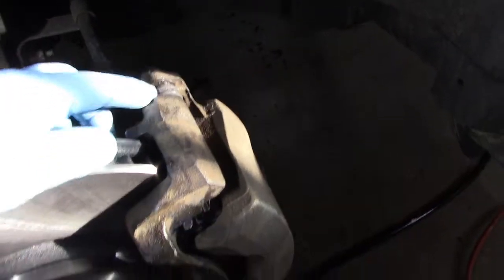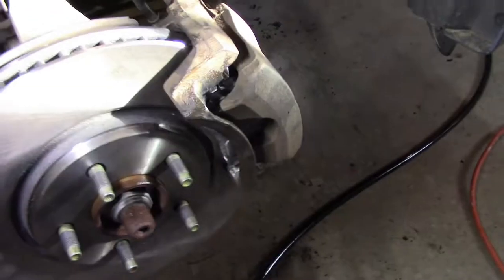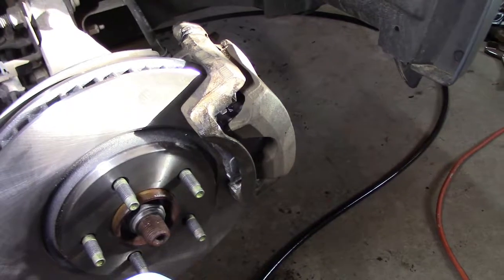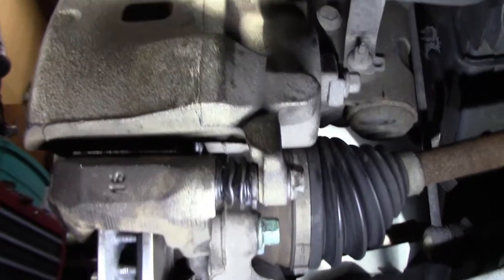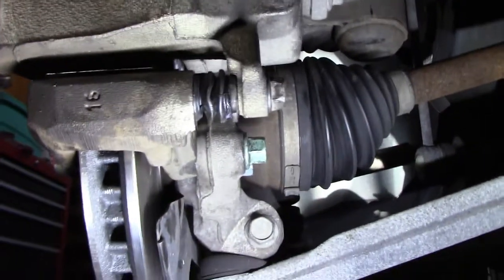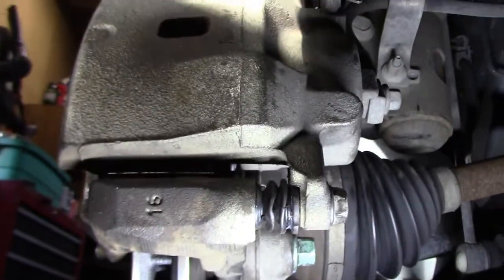Everything's looking pretty good so far. Boots look good. That's in the proper perspective. This is on, torqued to 26 foot-pounds. I also put some fluid film on the bolts. The hose looks good. Now I'm going to crawl underneath. Don't mean to make anybody dizzy, but bear with me here. We're going to shine the light up here. Look at the back side of things. Yeah, again, everything's torqued: 96 on the bracket bolts, 26 on the caliper. Don't see any leaks.